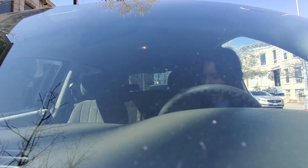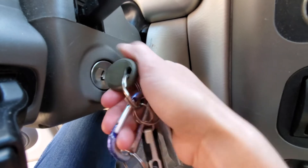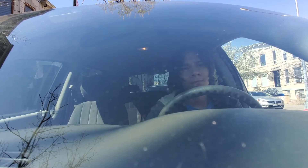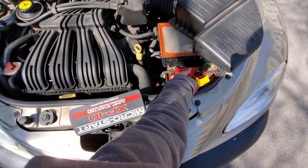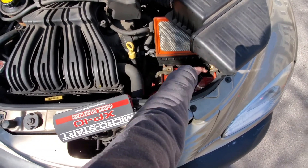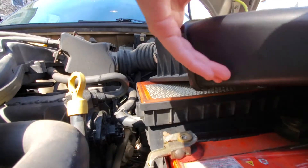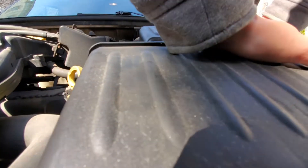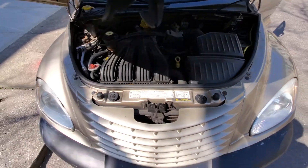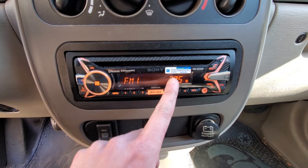The 15 minutes are up, let's try again. When your car successfully starts up, disconnect the MicroStart portable battery. If you have a casing for your battery, put it back on. Then close your hood and make sure it locks. If your battery was dead for a few days, you may need to change the time on your car's console.